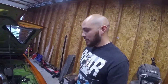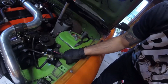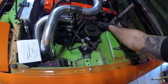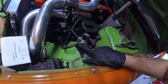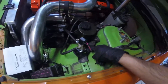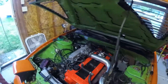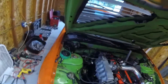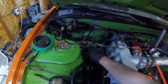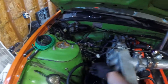Found a good spot to mount the boost controller — just used self-tap screws, got that in there. From the turbo I have it coming to the O-in port, and then the COM port is supposed to go to the wastegate. I have the harness tucked and plugged in, running all the way over there with the longer harness it comes with. I'm going to do some research, go ahead and go forth with it, and then show you guys.